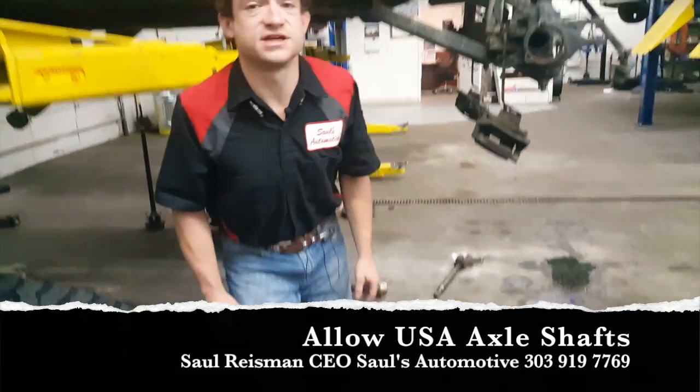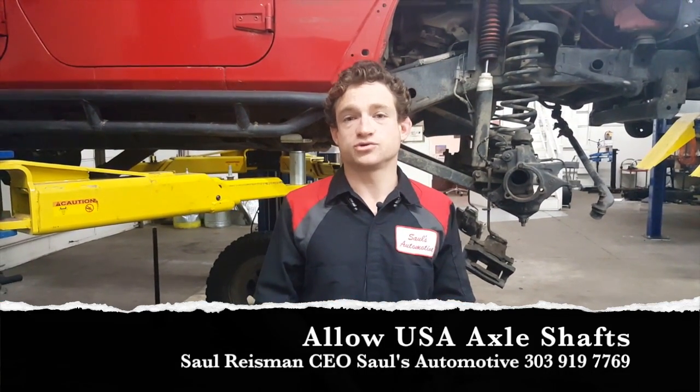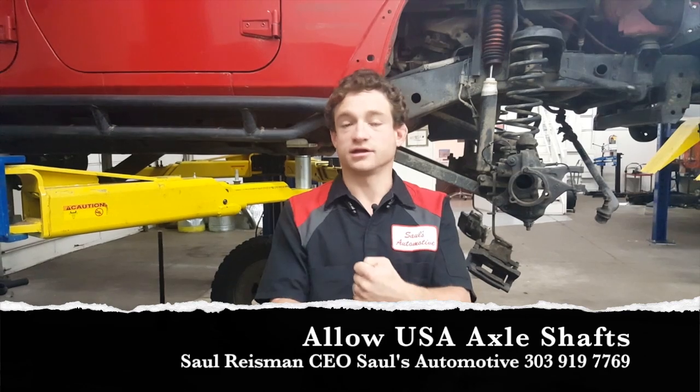These axle shafts themselves are 40% stronger than the factory shafts, and rather than a factory shaft that would simply crack like a cinder block hitting the ground because it is brittle, these are built from a more durable material that will actually bend like a bumper might if you were to hit it in a car accident.